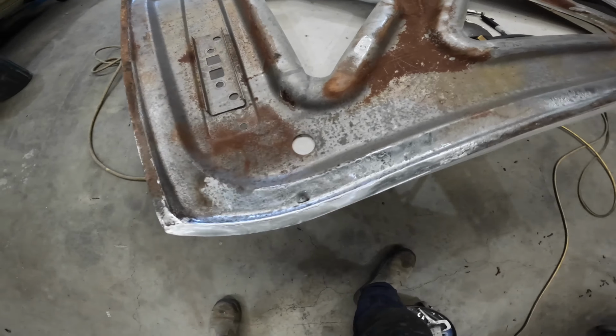All right, so I'm ready now that I've been around and tidied it up. I put a few little MIG welds in the corners and been over the edges, as you saw, with that little machine that folds the lip, which is pretty damn handy. It brings it down nice and flush. Yeah, so pretty much that's it, and I'm just ready to do the spot welds.